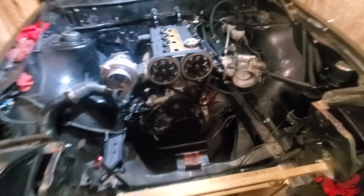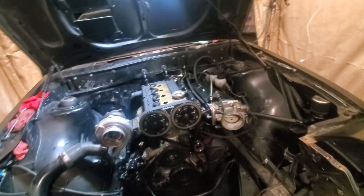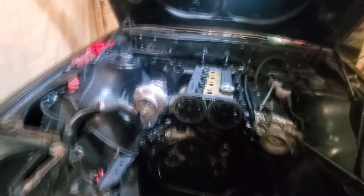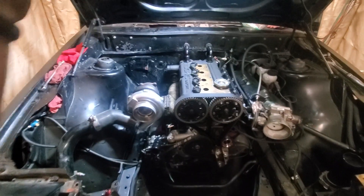It's back in — the turbo's just sitting on there for right now. This side of the motor is pretty much done: starter's wired, fuel injectors are in. The only thing left is the fuel pressure regulator — throttle cable's hooked up, still need to do some vacuum lines, the MAP sensor needs a vacuum line. We still need to do the radiator and coolant, clock the turbo, and make a new down pipe — pretty much just extend the existing one. Now let's see if it starts — there's no exhaust on it and no wideband, but it should start in theory.